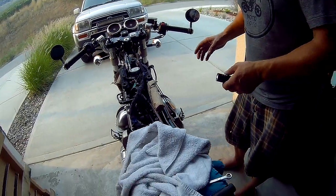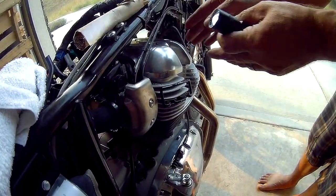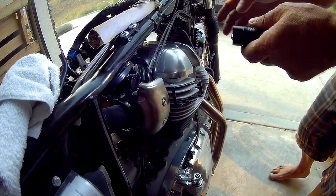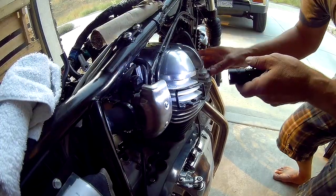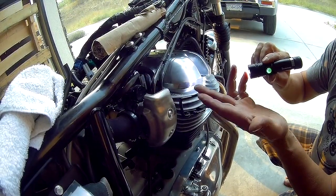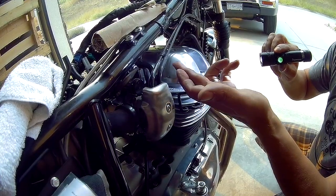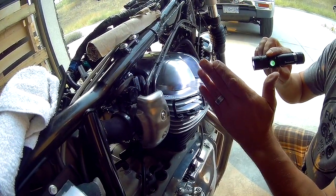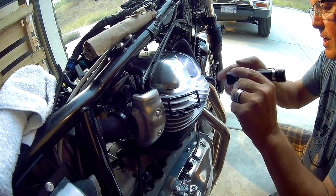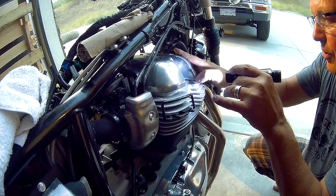What we had to do was still leaving the gasket in place. We started at the back, and I had to recruit my camera girl to assist me. So one of us on each side, and we were able to, with our fingers and with a long screwdriver, just sort of feed the gasket up into the valve cover, starting with the rear first, and then tilted the cover up at the front a bit, and do the same thing again, and just feel for it and get it all in there.